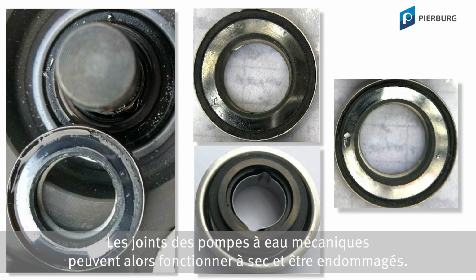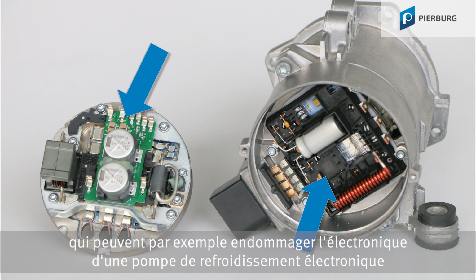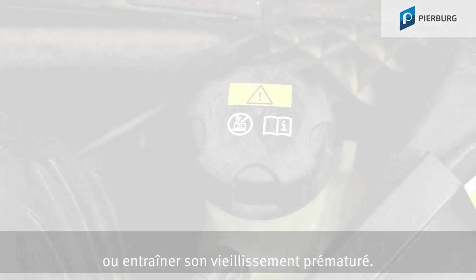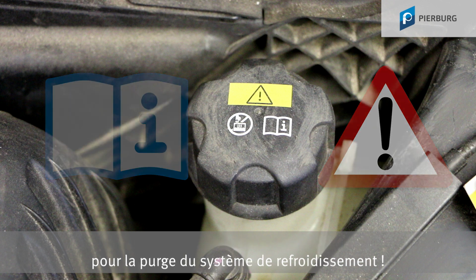This can cause the gaskets for mechanical water pumps to run dry and get damaged. The air bubbles in the system can cause localized hot points, which can damage the electronic components on an electrical coolant pump or cause them to age prematurely. So it's essential that you follow the vehicle manufacturer's instructions for bleeding the cooling system.